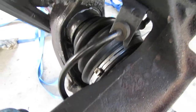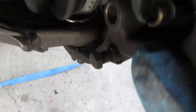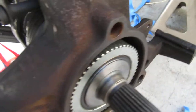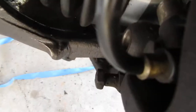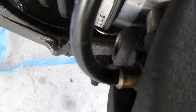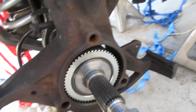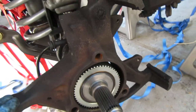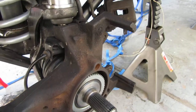It's in now — nice and solid. I got the ABS sensor cleaned up with brake cleaner. Your sensors are looking for impedances, and grease on the sensors will affect those readings. So a simple fix for some ABS problems is just clean the sensors off. I have been getting an ABS light, and hopefully between less vibration from the differential and cleaning the sensors, that fixes it.